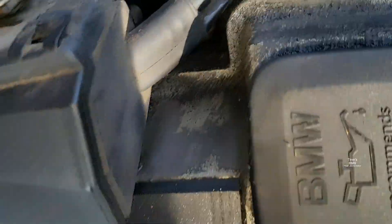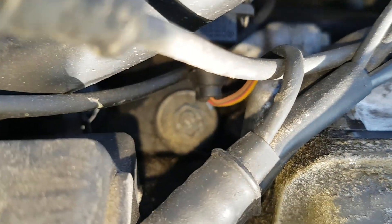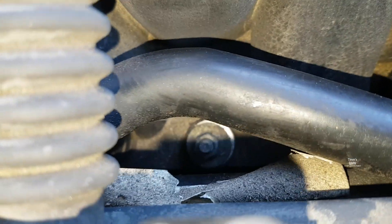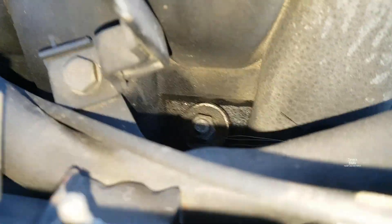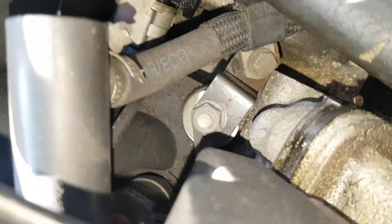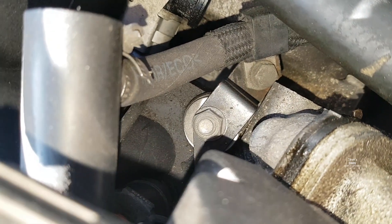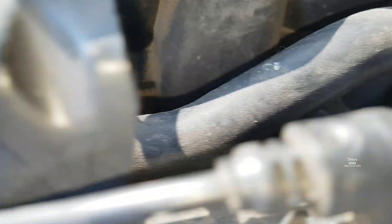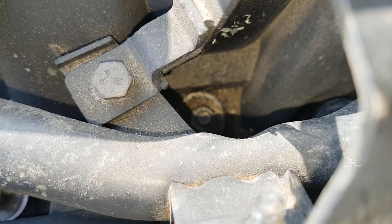There's a bit of room on the E38 but not much. That connector has to get out of the way. Number two is fine, number three is fine, number four is okay, number five — that jubilee clip gets in the way. Back on the right-hand side of the engine, that bracket has to move out of the way. You need to move that bracket — that's a 10 mil bolt or nut. Next one's fine, next one's fine, that's number nine — fine. Number ten is where we're going to start; it's a bit fiddly to get to.